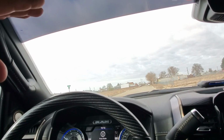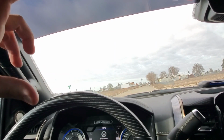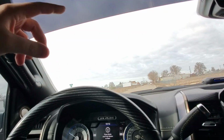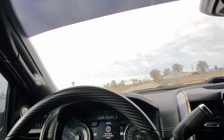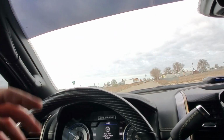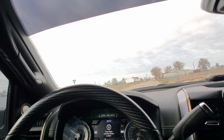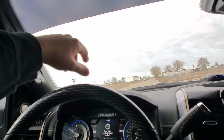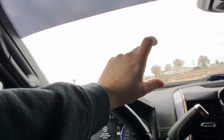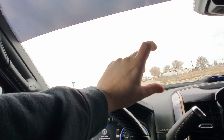So I pushed it all the way up, so the truck figured it was a little too high. I think I went from 45.5 inches from fender flare to the ground to about 44 1/4. So that dropped quite a bit, and that alone will tell you there's less pressure in there. So yeah, I couldn't be any happier. So what I was trying to say, driver's side, I pushed it all the way up. On the passenger side, not all the way up, because it just overdoes it in some way, shape, or form.